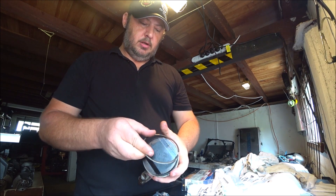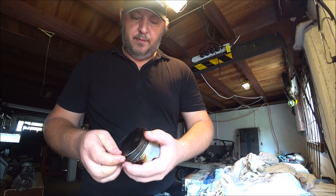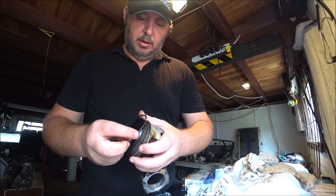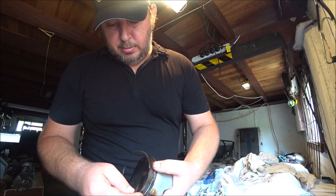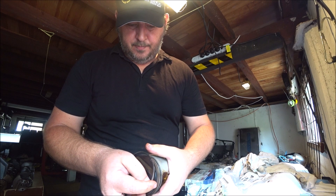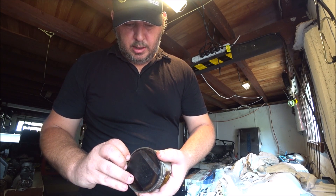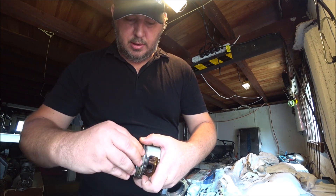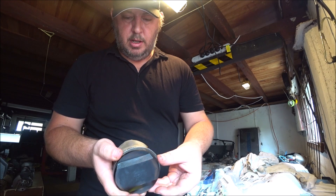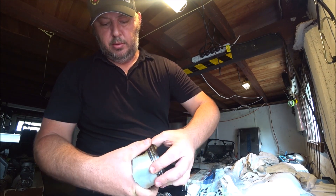I'll show you again on the top ring. Get it flat-ish on the low side, pop that in there — this one's a bit sticky because I haven't cleaned out the ring grooves. Pull it around. Easy as that, give it a squeeze, and then when you put the ring compressor on it, it pulls it all in together.